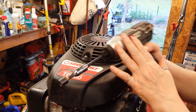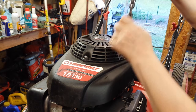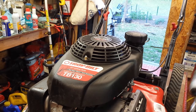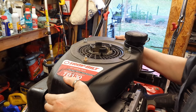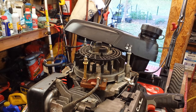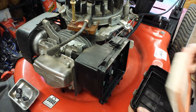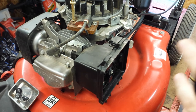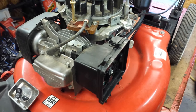I use a little light-duty impact driver to remove these things. You don't want to use an impact to put them back on, but it's certainly going to help take them off. The recoil starter pops off, and then we ought to be able to just lift off the fuel tank out of the way so we'll have better access to behind the carburetor. I've already cleaned the air filter and put in a new spark plug, so I know that's not the problem. It does start and maybe run for a couple of seconds if I put some carb spray in there, and the plug is completely dry, so I know it is definitely a fuel delivery issue.